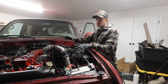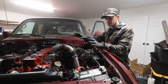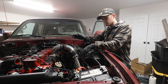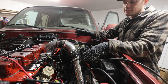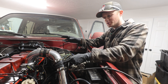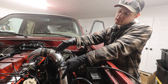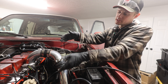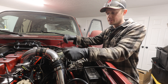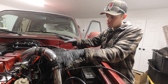So it got to where it was running really, really nicely, and then we had a boost leak — that's why it was running rich again. This connection was loose and came loose, so I tightened it back down. We need a longer hump hose for this section of the intercooler piping — they make ones for semis that are six inches long. Six inches should be long enough. We should be good to start it again and it should be running smooth.